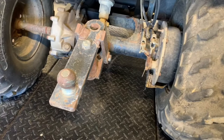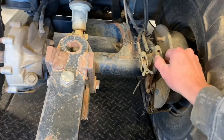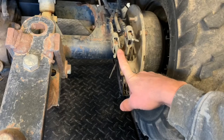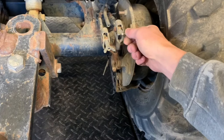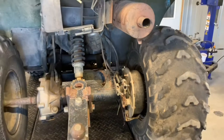There's a custom trailer hitch on the back that I would not suggest — it looks dangerous and you're going to end up destroying your rear end, which is exactly what happened on this one. Behind your right wheel are your drum brakes for the rear. You've got two cable adjustments here — one goes to the foot brake, one runs up to the hand brakes. Make sure both are adjusted properly using these butterfly nuts. You don't want the brakes always engaged or you'll wear those brake shoes out quickly — leave a little bit of slack so you can wiggle them.